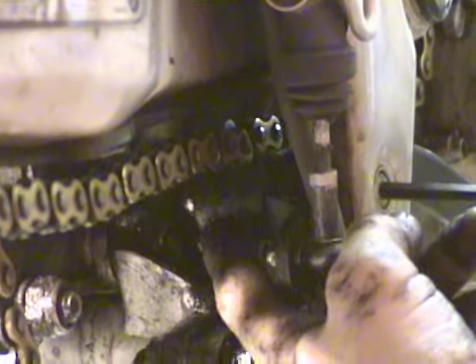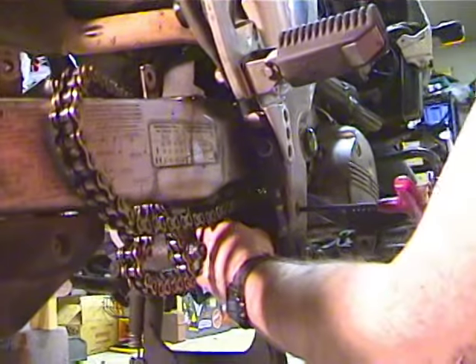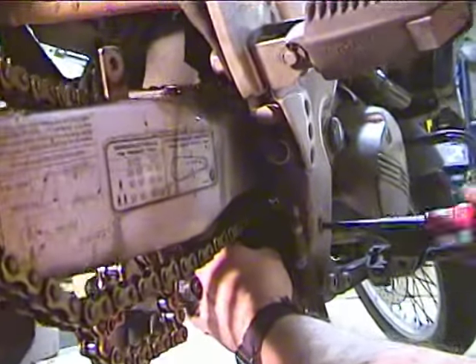This is the bottom roller. I'm going to get a 13mm wrench on the nut and remove the bolt. This is also the brake pivot bolt, so this gets kind of interesting because there are some washers and stuff in here.